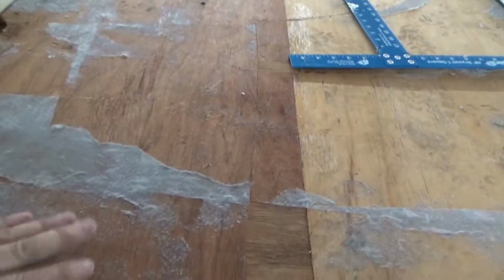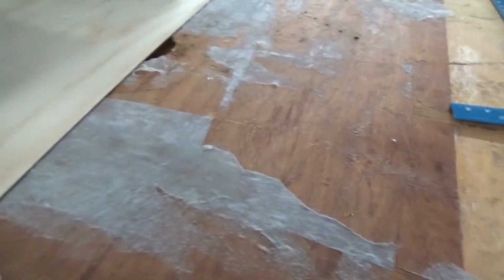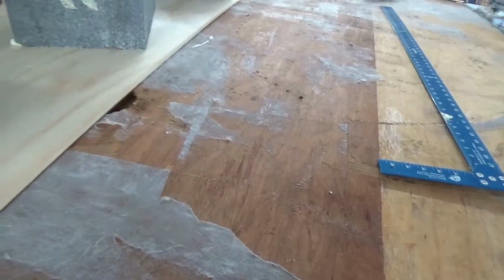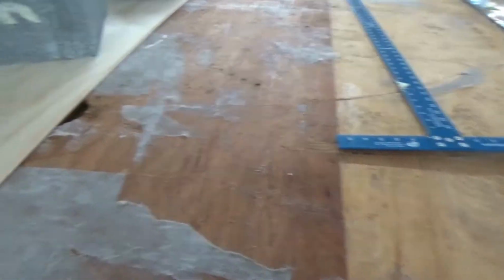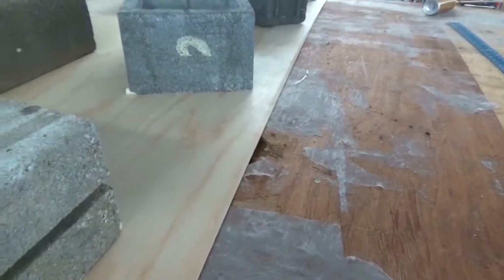And then when we put the new glue down, it would really make it soft, and then it gets all balled up. You don't want to do that. Then you'd see it under the roofing. So put a new roof deck down, and we got one more piece to go. And we're cutting some roofing now. And then once we get all that squared away, we're gonna get the roofing adhered down here, and we're good to go.